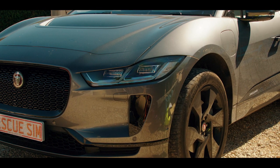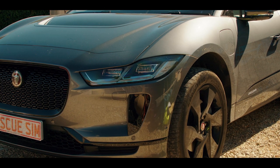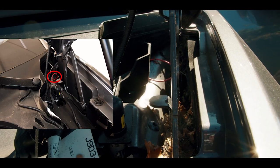If you need to release the charging cable with 12 volt power, unlock the vehicle, push the release button on the charging socket and then disconnect the charging cable. To release manually, open the front luggage compartment and pull the release cable located near the bonnet hinge on the passenger's side, then disconnect the charging cable.